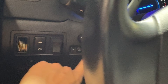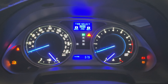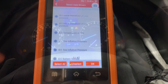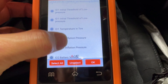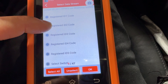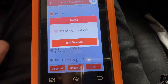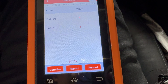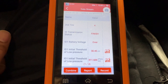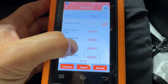If you didn't know how to switch your TPMS, you basically go over here and scroll across until you see the menu — you can go to main set and then second set right there. One thing I found on the data stream for TPMS is that you can't read the registered sensors for the second set because for some reason it's not listed in any of these menus. You can only read the registered IDs for the first main set even though you can see main tire and second tire on the menu. You can see they have four programmed to them but you can't see what's stored. One thing you could do is select all, create the report, and email it to yourself.